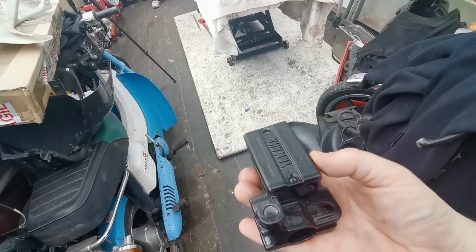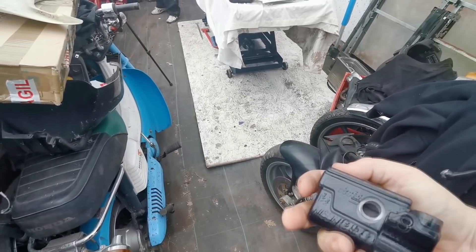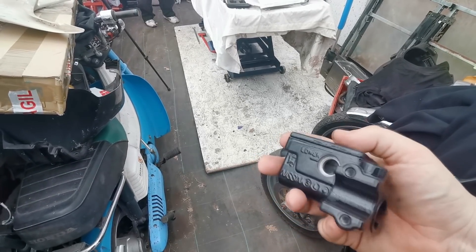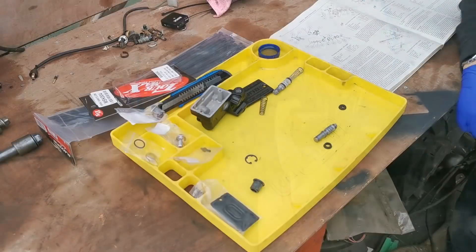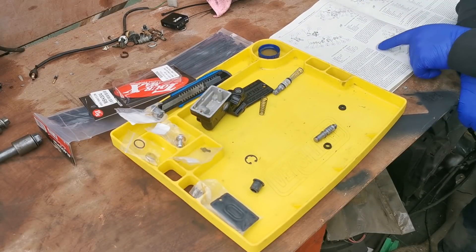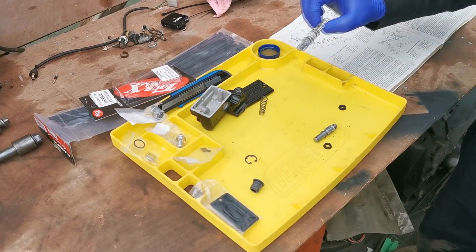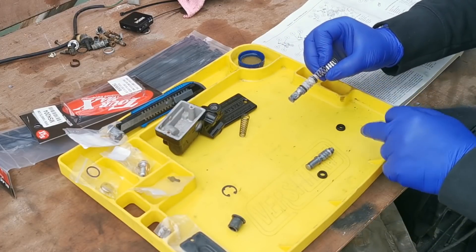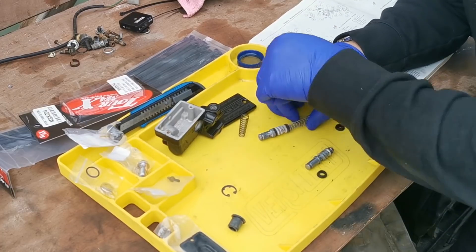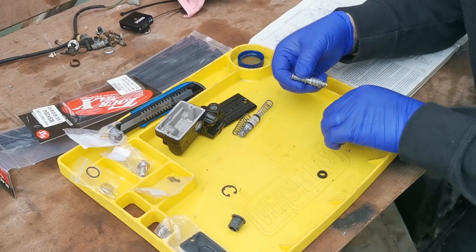While we're in here, I thought what we can do is quickly rebuild this brake master cylinder because I've got the rebuild kit for it. So once we get that done we can maybe get that on the handlebars in the next video with some of the other switches. So we've got the Haynes manual here, but the Haynes manual doesn't show you a breakdown of the way the seals go - it's only a line drawing rather than a photograph. Lucky enough we've got the old master cylinder internals so we can actually see what way the two little seals go. It's very easy to put them back to front.